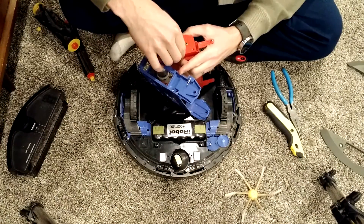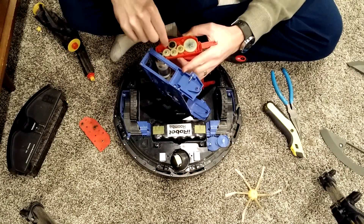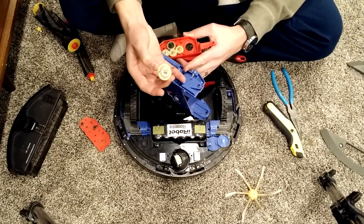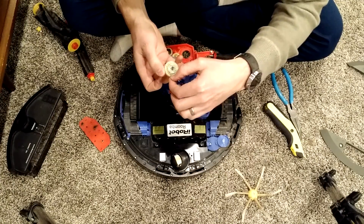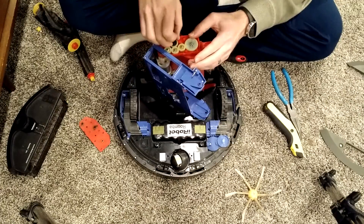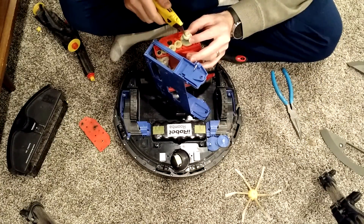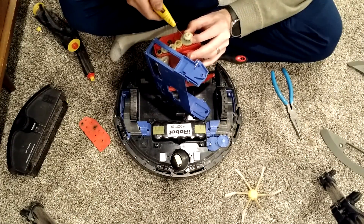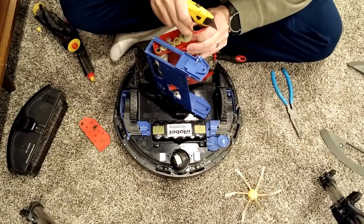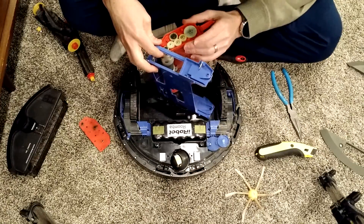Once you have the screws off, this plate just lifts gingerly up. And here are all the gears — they should be greasy in there. That's what you're looking for right there: the clumpy, dirty hair that prevents these things from spinning well. That one's for the big brush; I think this one's for the small brush. When I first got this — I got it used off eBay — every single joint area had dirt and gunk in it. I cleaned each one and it worked like a charm. The sharp flat blade really helps. So that's pretty much clean.